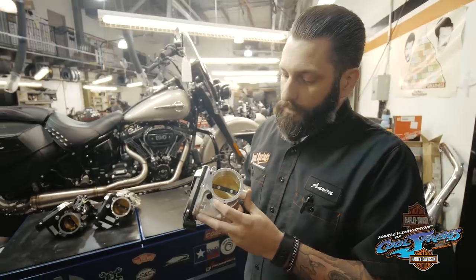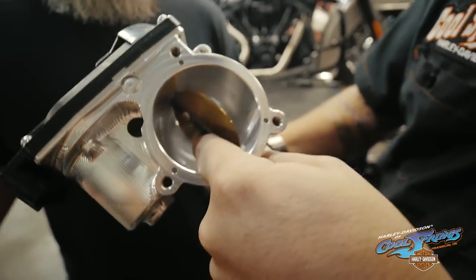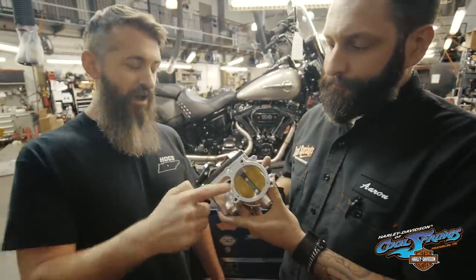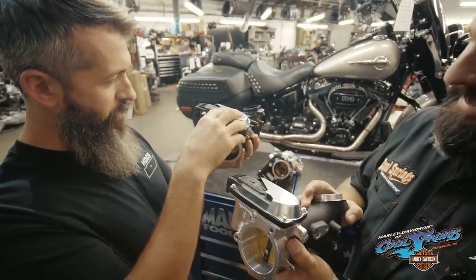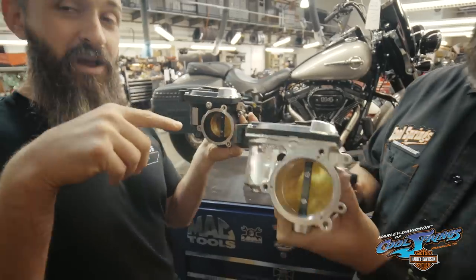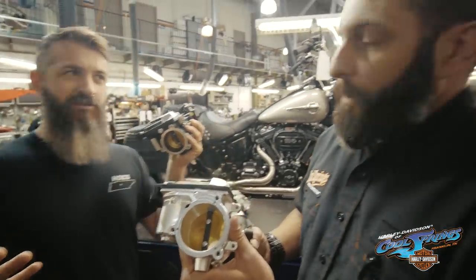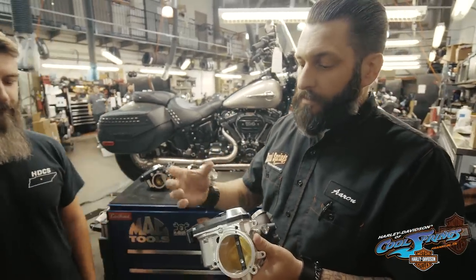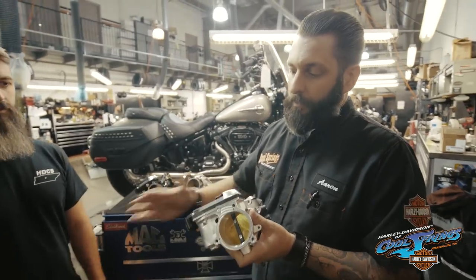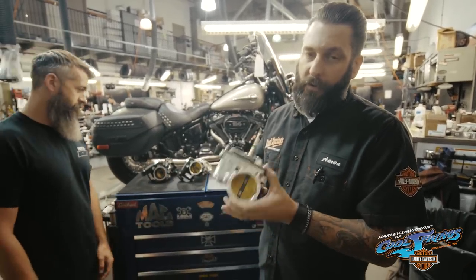As Jamie was saying — get a close up, do you see this? I want to put this on my bike because of how it looks, even though I can't see it. It's amazing. So when you get these HPI throttle bodies, you have to send the throttle body to HPI with your factory throttle body. They're going to take this motor thing off — the one that works the butterfly. HPI installs it onto their throttle body and sends it back. That takes about a week. Every single one we have swapped by HPI, they actually send us what amounts to a throttle blade dyno, showing the actuation of this blade and proving it works properly so that when our customer gets it, we put it on the bike and won't have any issues with throttle blade control.